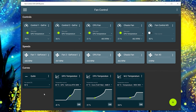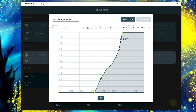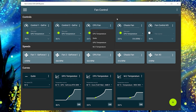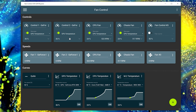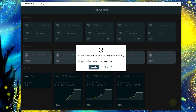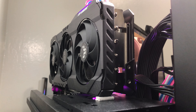Luckily, I've found a fan control software that helps me eliminate all the issues. I could create a custom fan curve for the 3 fans on my graphics card, so that they would not spin until the temperature was 55 degrees and up. With this software, you can create a fan curve for any temperature sensor such as VRM or M.2 SSD, so technically you can control the GPU fan speed according to the M.2 temperature. This software is the combination of Asus AI Suite 3 and GPU Tweak 2, and makes Asus ashamed of themselves. The version I'm using is 59 because the newer version could not control the fan header on my AMD X470 motherboard, however newer versions work fine on my Intel Z390 board. I will have a link to the creator's YouTube channel and GitHub in the description.